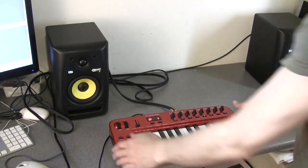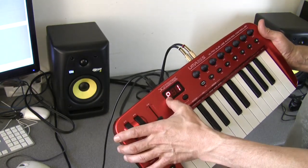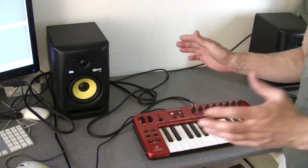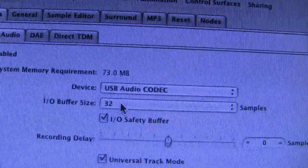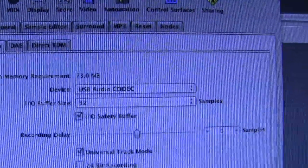Welcome back. I'm on a Mac here. I've plugged in the USB and the device comes on, defaulting to show P1 - preset one - on the LED display. I've wired it up with some gold-plated oxygen-free RCAs to the line outs. The device was instantly recognized by the Mac with no need to install drivers because of Core Audio. In Logic Pro preferences under audio, the device appears as USB Audio Codec. I selected that and got the buffers right down to 32 samples - the same as the Apogee Duet or any other pro or semi-pro device - so you get nice low latency.